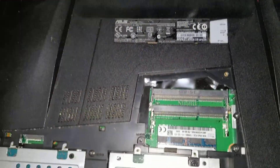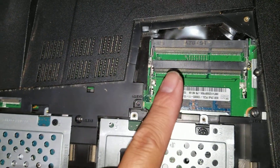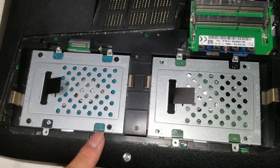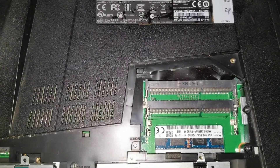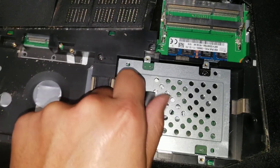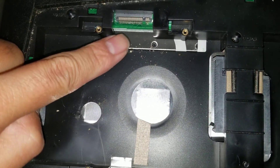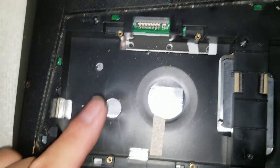After you get all those clips out, you can see in here there are two slots for RAM. On the other side, there are two more slots for RAM. First, you want to remove the hard drive screws — each hard drive is held in by four screws, then you just slide it to the side. Take one hard drive out here and then the other one here. Yours might have an M.2 — I believe this might be an NVMe slot, I'm not sure — but it looks like there's a slot here for an SSD.